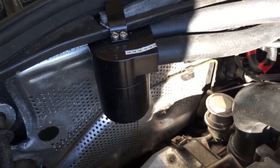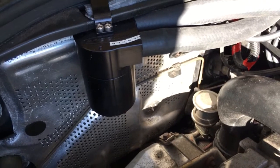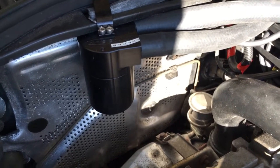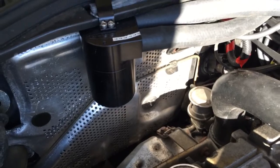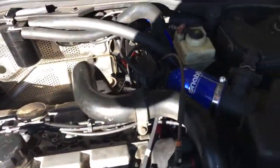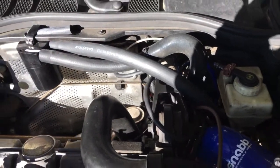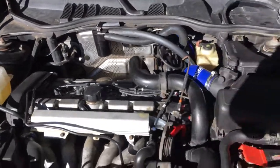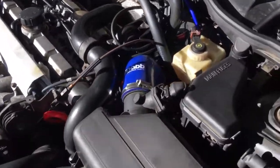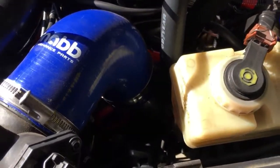The other thing I did was take the output from the PCV into this BMS catch can, which is usually for BMWs but you can get it from Burger Tuning — it's a great catch can. I vent to air and it's been working great. The car has been running great; it's a '98 S70 with great performance.